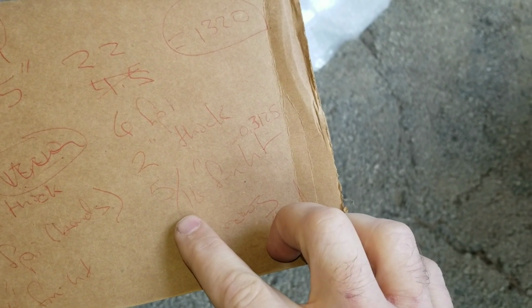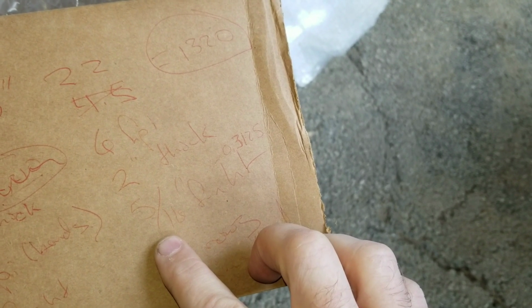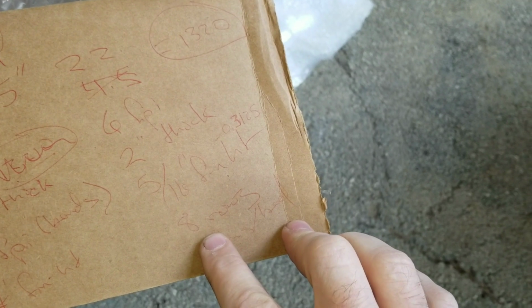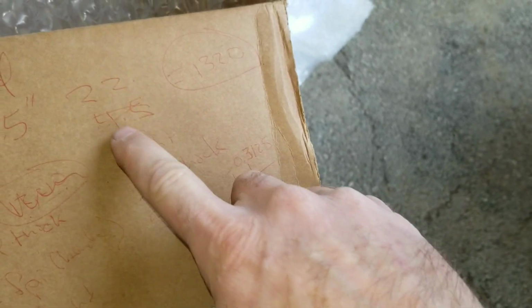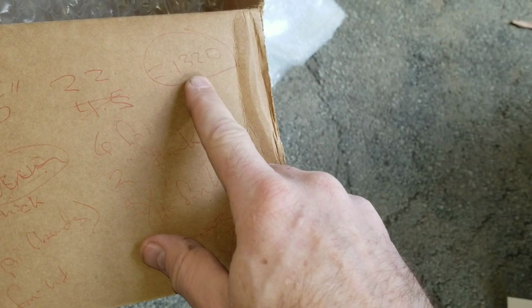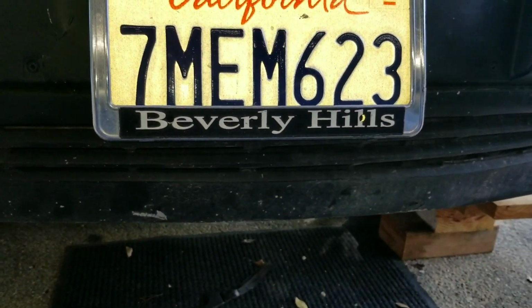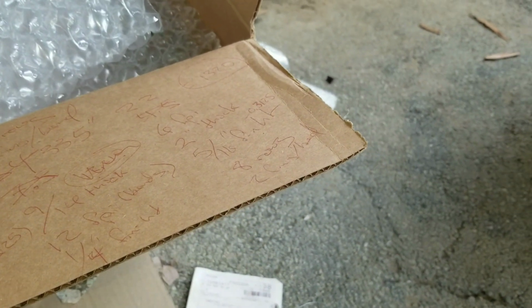The actual height of each fin is about 5/16 of an inch. So when you multiply 22 inches times a down and an up times 8 rows times 5/16 times 2 inches thick times 6 fins in a linear inch width-wise, you get 1,320 square inches of fin area on the stock W210 intercooler. Basically the planform or frontal area of that intercooler is, as I mentioned previously, about 22 inches on the core, and only about 4 inches high, so it's 22 by 4 plus the end tanks.